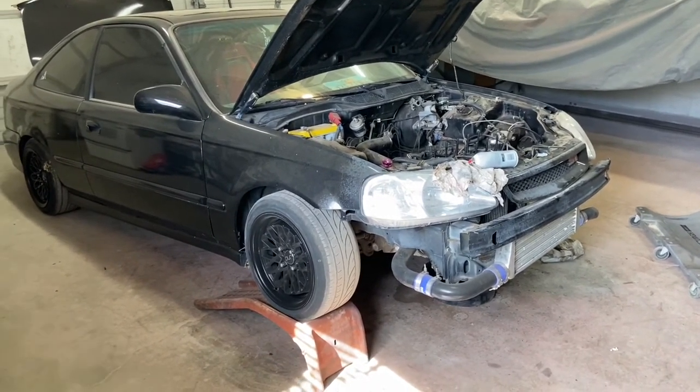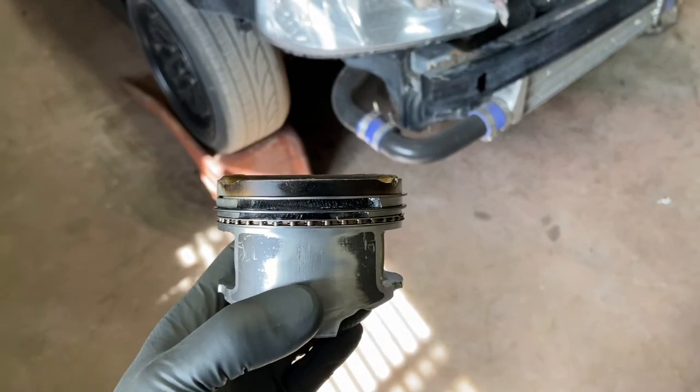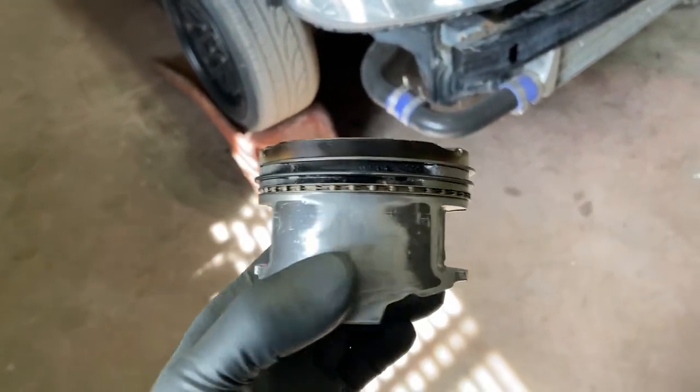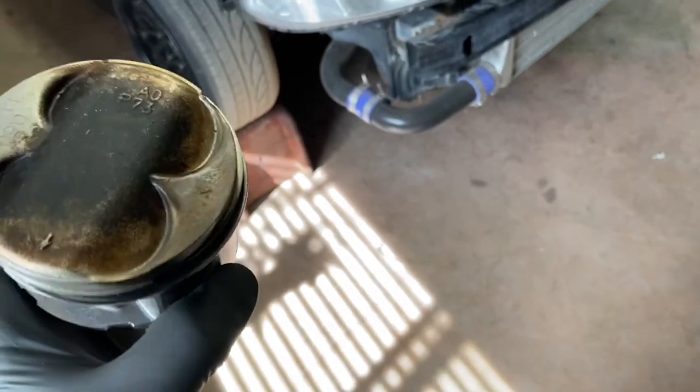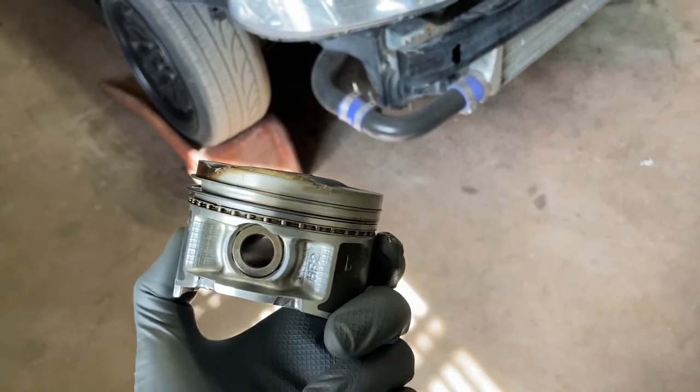it went wrong. So he brought it to me and he said, "Can you fix this? I don't know who to trust or what to do." Well, I've already done work for him before and I'd be happy to help him out. He thought it was a head gasket issue, but obviously it wasn't. It was blowing oil everywhere. Well, you see, they had stock pistons, stock ring gap, and popped the ring lands.